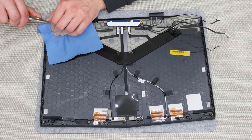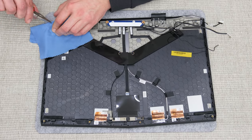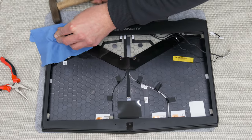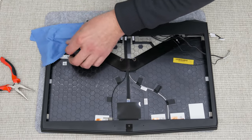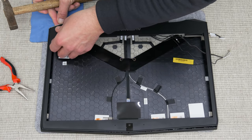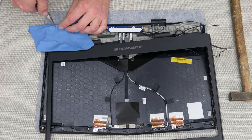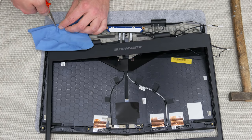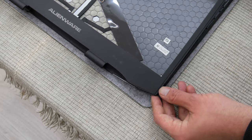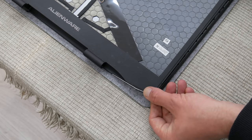And the last thing. To the top of the case, I have to fix the curved aluminium. So here I used some cloth to avoid scratches. I used a hammer and long nose pliers. Here, between the bezel and the case was a gap of about 1 mm. It's not a lot, but you know, it looks ugly. Anyway, after some work, the gap is gone. And the case is like new again.